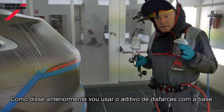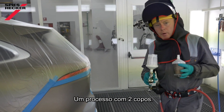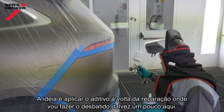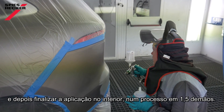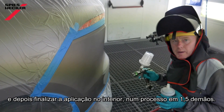On this occasion I'm going to be using the blender along with the base coat — a two-part process. The idea is I spray the blender out around into the areas where I want to make my blending, maybe a little bit down there. Then I change over and make my base coat, spraying to the widest area first, out across here, and then finalizing the repair in the middle with one and a half coats.